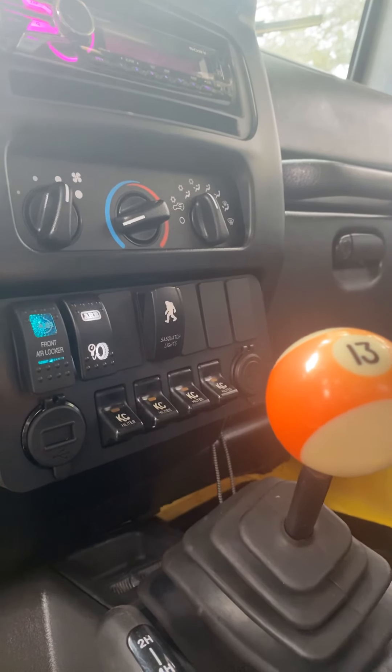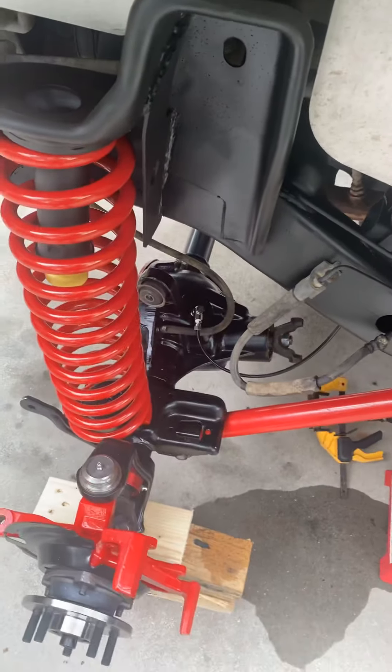You will hear a hissing sound if you mounted your compressor in the cabin. And that is actually not a hissing sound — that is actually the fan cooling the unit. But when I first did it, it ran continuously. And it's not supposed to do that. That is, as they say, no bueno. So, it said you have a leak somewhere. So I went back and I checked everything. I checked all the fittings down here with some soapy water — perfect, awesome. So clearly, the leak is in or around the fitting on the solenoid. So I go back and look, and I didn't even have to put soapy water on it. I felt it, and there's air pouring out around the fitting that goes in at the solenoid.